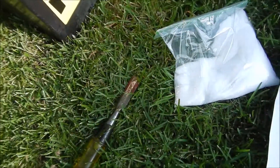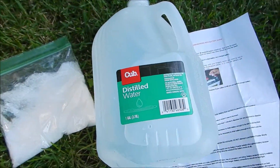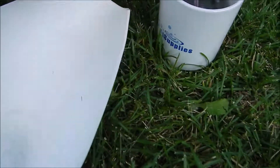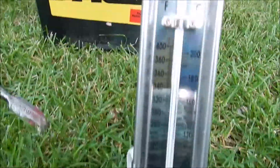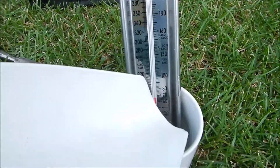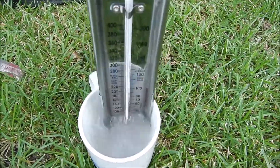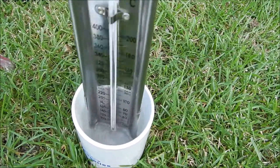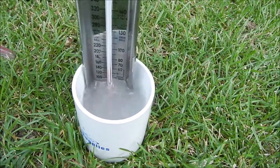Dissolve the desulfator in 150-degree distilled water. Very few impurities can really wreck a battery, so don't use tap water — use distilled. I've measured out my materials: this is one ounce of the battery desulfator chemical. The water is at about 155 degrees Fahrenheit — they recommend 150 but say you don't have to be too precise. Don't breathe any dust. I have no idea what these chemicals are, so make sure it's fully dissolved in the water.